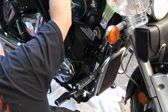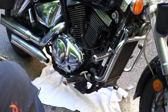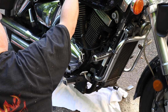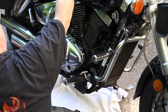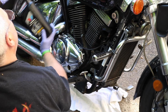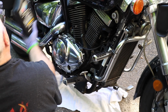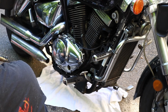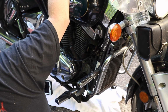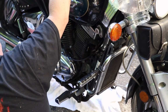And then once we're at bike level, just at the bottom of the window. All right, once we fire the motor up, I might have to add a little more anyway, but that's not going to happen until after I get the exhaust done and the early adjustment on the clutch done. Add about a skosh or so. That's a big skosh nonetheless. Maybe another. Make it a skosh and a half. Let's see how we look now. Yahtzee. Right up to the full line, which is exactly where you want it before you start the engine.